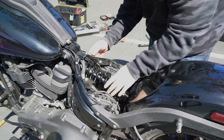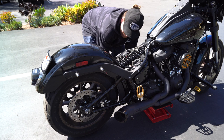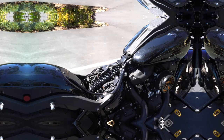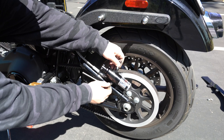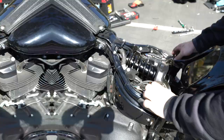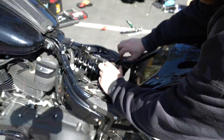This is where the center stand comes into play. You're going to need to lift your bike up into position so that the new shock will line up with the lower mounting position. Just go up and down on the center stand until you find the right spot, and then tighten the lower mounting bolt into place. After you've tightened down the lower mounting bolt, make sure you do the same with the top one — pretty tight, but just not torqued down all the way. Once the top and bottom bolts are both tightened, go ahead and tighten the bracket around the remote reservoir. Do not over-tighten this; you want it just tight enough so that the reservoir doesn't move. Once everything's in place, torque down both shock bolts to spec — I'm pretty sure it's like 65 foot-pounds, but check your service manual to be sure. Don't forget to replace the guard and re-tighten the retaining screw on the bottom shock.